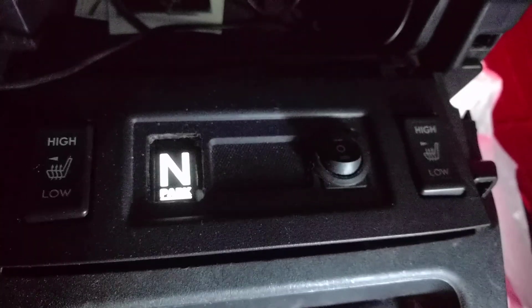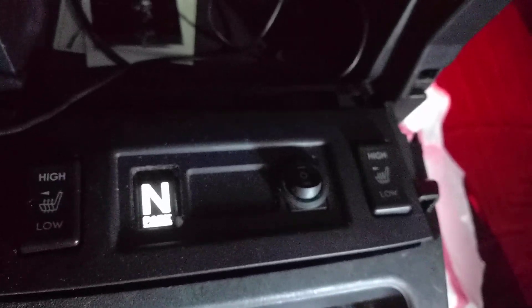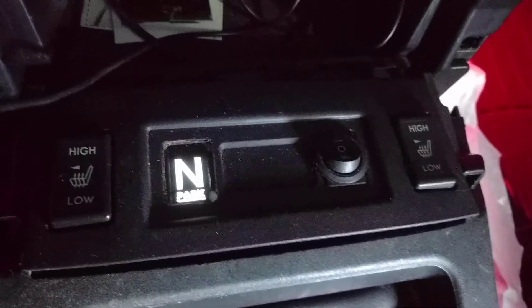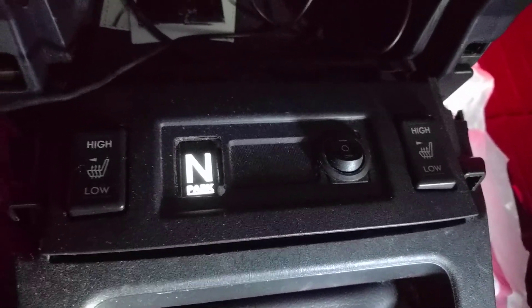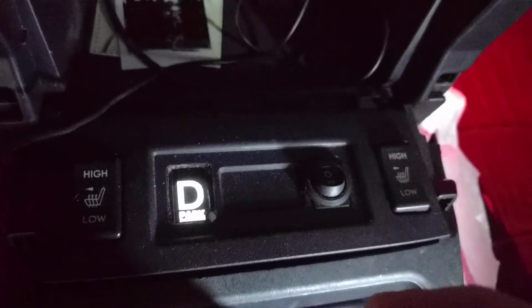Stepping up from simply reading in-car signals — I had to use opto-isolators to do that, because you're going from 12 volts for the car signal down to 5 volts for the Arduino inputs. So going from just reading those signals to detecting the exact gear I'm in, in this second mode, the middle mode here is currently off.